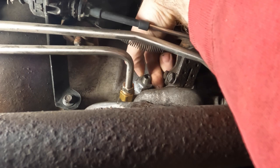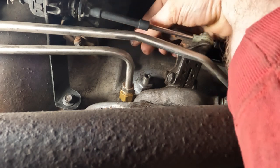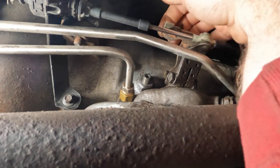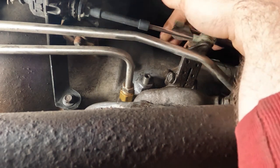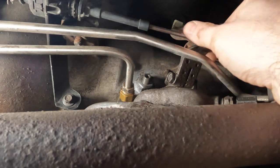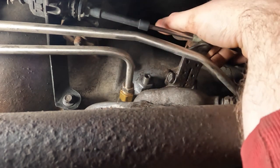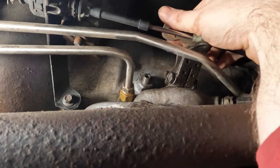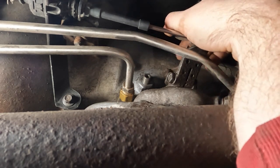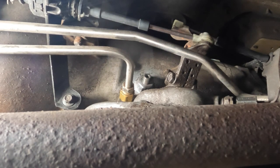I can feel that there's not a whole lot of pressure on that set screw, so it probably does need to go in further. Now we're going to go ahead and remove this spring — this spring goes to the kickdown linkage up here. This one right here is the gear shift linkage. We may also have to remove that. Both just pop straight up, but being an older Jeep I don't like to pop those off if I don't have to, because sometimes they may just break.